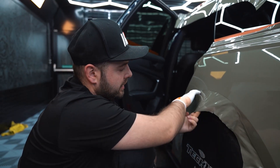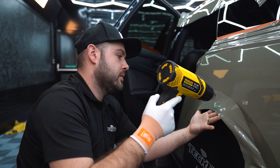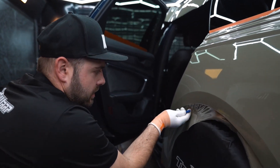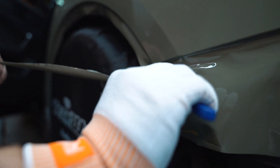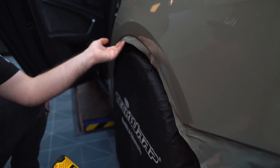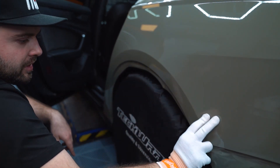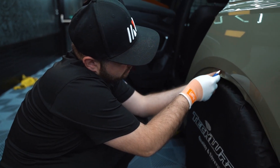Now I'm going to apply some heat all around the edge to relax the vinyl. I'm not stretching it, just relaxing it and holding it to cool down. I'm going to cut it slightly shorter all around, then hit it with heat again so this edge will be relaxed — there was a lot of stretch. You can see there's no tension now, so we let it cool down, pass our finger again, and trim it. I always trim it exactly behind the edge.